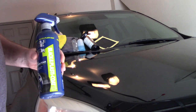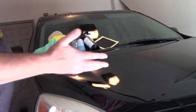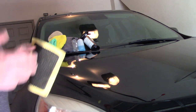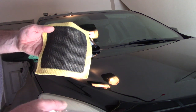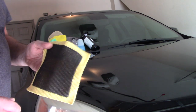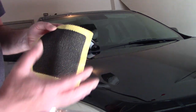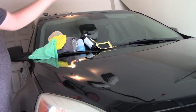I have many videos on how to use an iron remover, but I want to go through these steps quickly. So we wash the car, use an iron remover, rinse the vehicle off, and now we want to clay. We want to do this out of direct sunlight on a cool panel if we absolutely can — that's going to give you the best results. Why clay after an iron remover? Because there are bonded contaminants on the paint that an iron remover will not remove. Use a clay bar, clay towel, or clay mitt — whatever you have in stock — and lightly clay the vehicle after the iron decontamination.